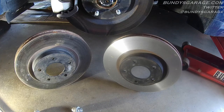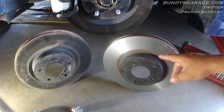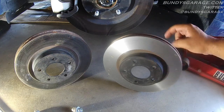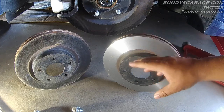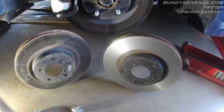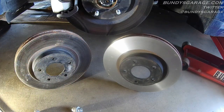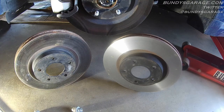To get rid of that wave, they go in there and cut a new surface onto the rotor. These rotors heat up thousands of times during the life of a rotor. So this rotor has already seen hot and cold cycles — it's been seasoned. I think you are better off getting a rotor turned than buying new rotors because a seasoned rotor has already seen the heat cycles and probably isn't going to fluctuate as much. I have seen brand new rotors after 300 miles already have a pulsating brake pedal. You can have rotors turned at most major automotive stores — just call before you bring it there to see how long it will take, because your vehicle will be inoperable while they're turning the rotors. You'll save more money having your rotors turned than buying new ones. Best practice is to have your rotors turned when you're doing a brake job.